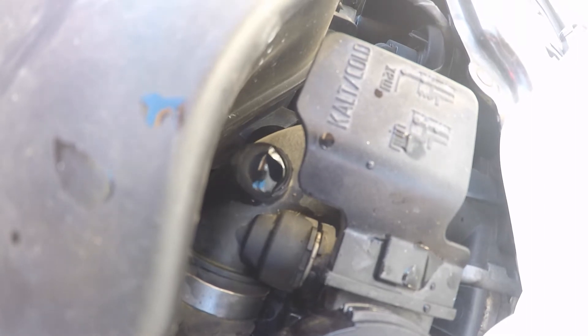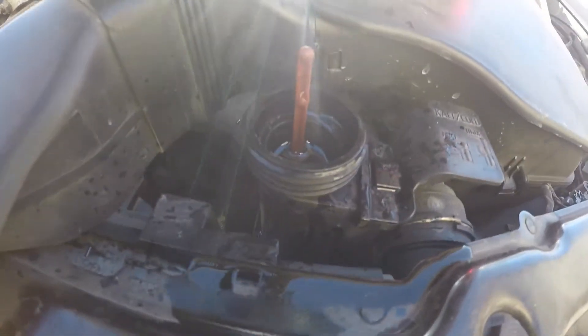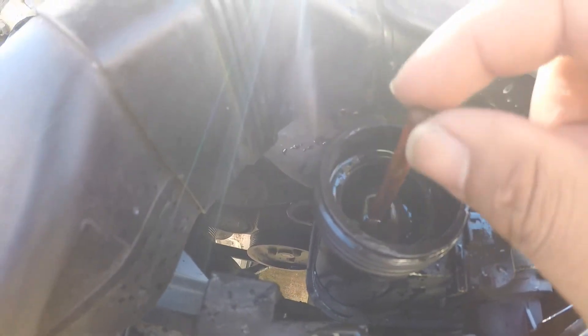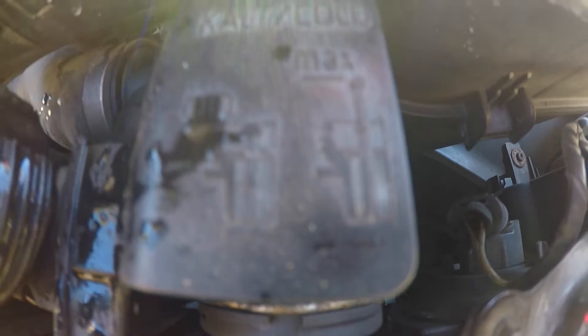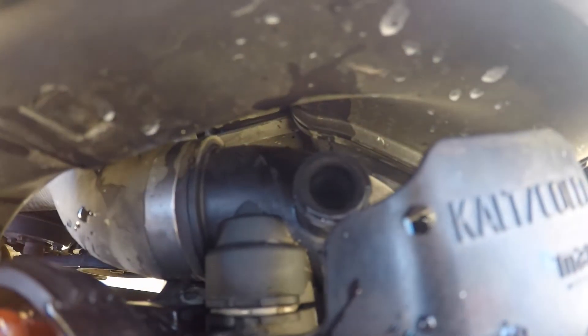There were air bubbles, but now it looks like there's just water, so I'm going to stop right there. What you end up with is your expansion tank actually overfilled — there should be some play in there and there's a diagram showing where it should be. Since it's overfilled, I need to cap off the bleeding port and use a turkey baster to remove all the excess water.